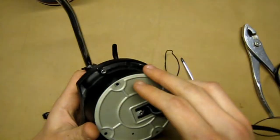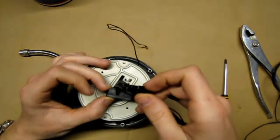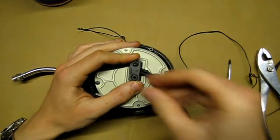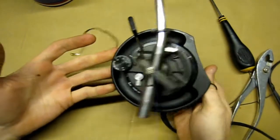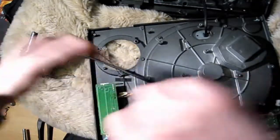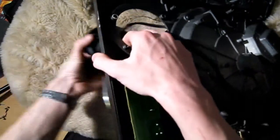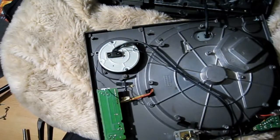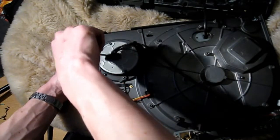You're pretty much done. Put the metal plate back on and then put the two black screws back in. Once you've got the screws in, put the plastic piece back on and then put the two screws in and screw that down. That whole assembly is now ready to go back into the turntable, which is pretty much just the reverse of how you took it out. If you want any more information about the screws and the tonearm assembly, the appropriate links are in the description.